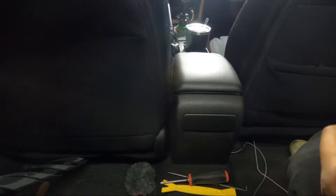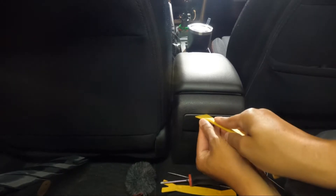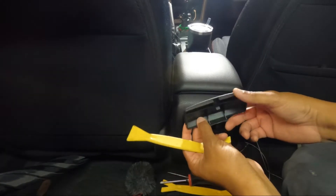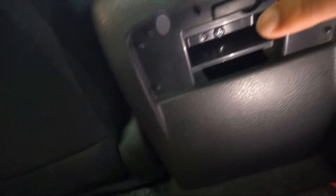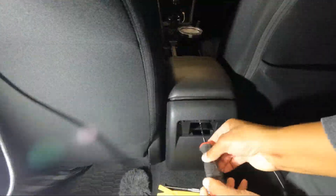Here we are in the back seat of the car. I've got my pry tools — that's what we need to use to take this off so we don't scratch anything. We're going to pry underneath and pop this little cover off right here. Put that to the side and get a little light in here. Inside there is a screw that has to come out right back there — hopefully y'all can see that — so we got to take that screw out.